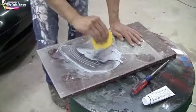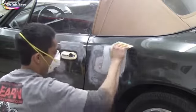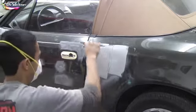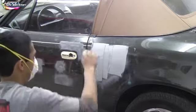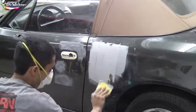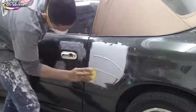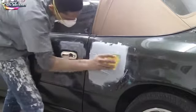I want to start with my biggest piece. When applying body filler, you want to push firmly to take all the air bubbles out and reduce pinholes. If you don't push firmly enough you're gonna get pinholes — little holes in your Bondo after you sand that you're gonna have to refill. You want to push firmly and go in multiple directions. Now I'm going sideways, then I'm gonna go back downwards again.